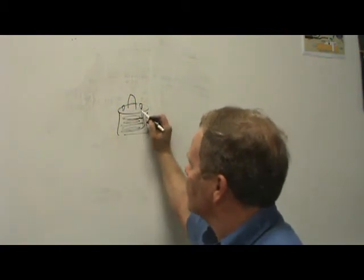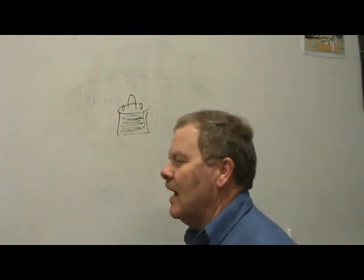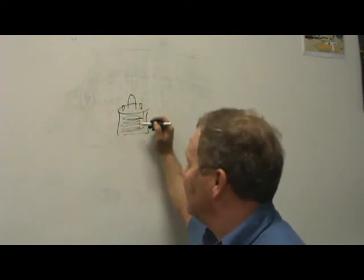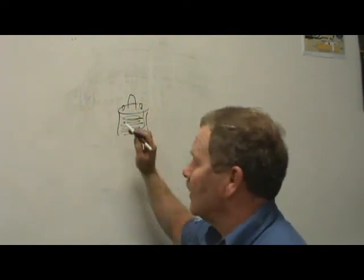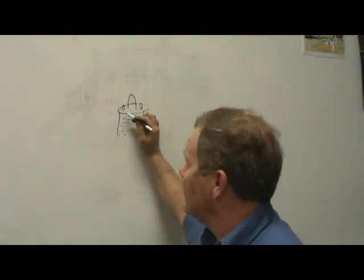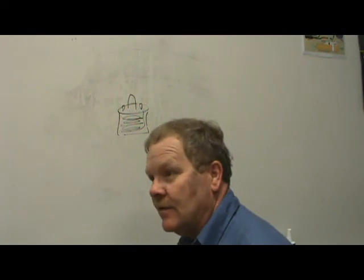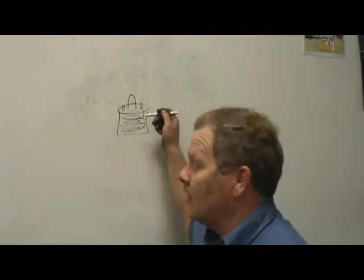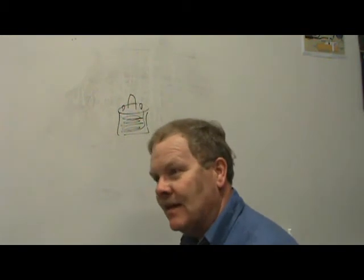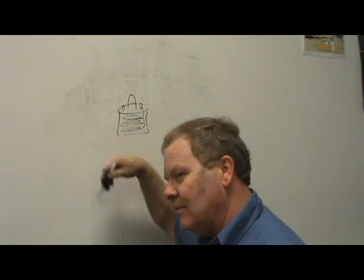And the workhorse, this one here, we're going to do math here. Let's say this one here has 100 windings, and the secondary will have 1,000. So you're trading the current that you got here for voltage by a factor of however many. If you got 100 windings here and 1,000 windings there, you're multiplying it times 10. See, that's how that works. Basically, the primary windings, however many more you got.